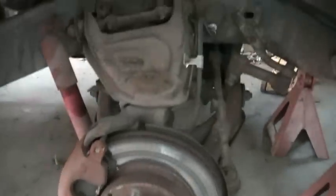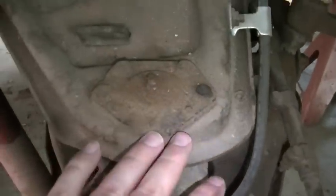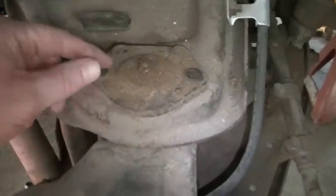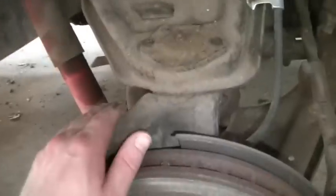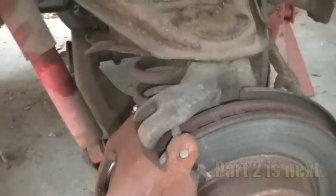With the wheel out of the way we can get a good look at what we're dealing with under here. You can see my control arm bushings are just completely shot — both upper and lowers. The shocks are probably in pretty bad shape too. This ball joint is still riveted into place, which leads me to believe this upper control arm may be original to 1977. Usually when you buy new ball joints for these trucks you've got to grind off the rivets and the new ones bolt in. So it's possible they just bought new upper control arms like I did with my lowers, but it's also possible these are original and almost certainly need to be replaced. I'm going to start with the basic stuff — get the caliper off, get the rotor off, get the shock off, and then work on getting all these suspension components separated.